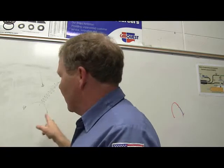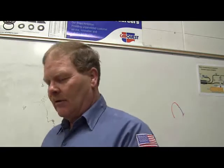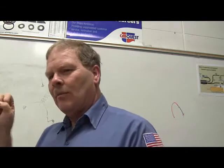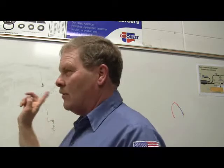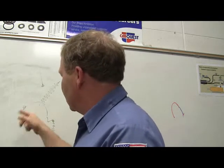And if you turn on the key, and you unplugged your sending unit where it was screwed into the engine block or wherever it was, and you hooked your test light between ground and that, if you saw a blinking light, then you would basically know you had a good circuit all the way through, that your gauge would actually start moving because the test light would provide a ground for it. But that's how you would check to see if that circuit was good.